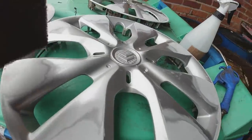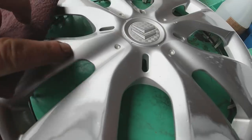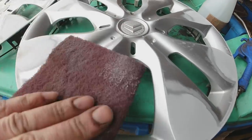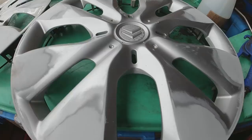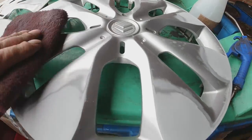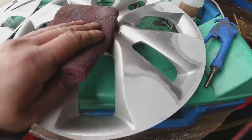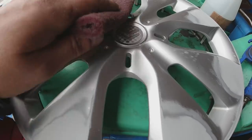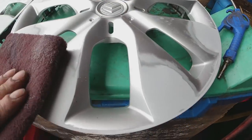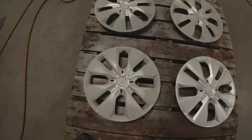What we have to do now is go over it all with an 800 grit Scotch pad, because if you paint onto these shiny bits without keying it up, the paint's going to flake straight off. You just have to get in there with the Scotch pad and key it all up — basically get rid of all the shine so that your paint has something to stick well to. We've got one coat of filler primer on and we're just about to put the second one on.